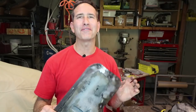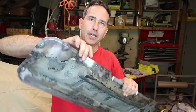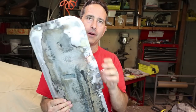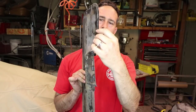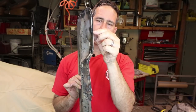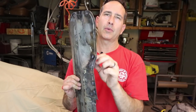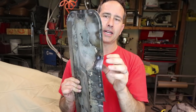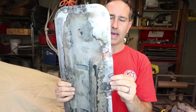All right, take a break for an update. I did get the flange, I basically brute forced it around this feature here. So you saw how this flange didn't want to behave as it went over this curved area. It had a tendency to suck in. So by doing some relief cuts and sort of massaging it, I was able to get a pretty even displacement over the edge.